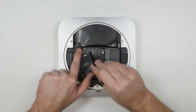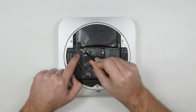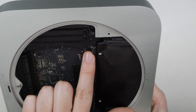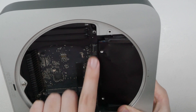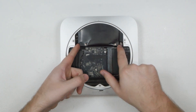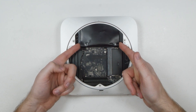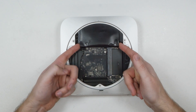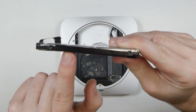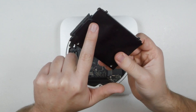With that done, unplug the next plug by getting tweezers underneath and lifting it gently up from the board. That is the plug that connects the SATA drive to the main motherboard. Once it's undone, get your fingers on either side of the drive, tilt it up as far as it will go, then pull it towards yourself to slide the drive out.